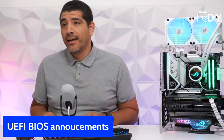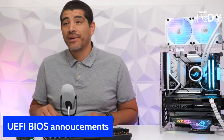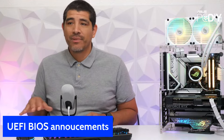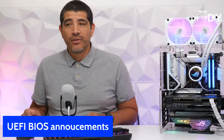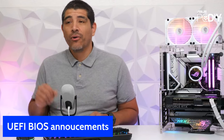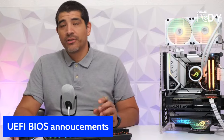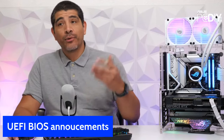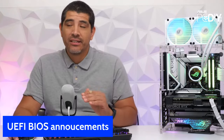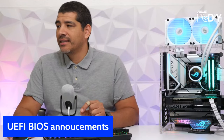So maybe you're running Z690 based motherboards, or maybe you're running one of the other socket 1700 series like B660 or an H series motherboard. We've continued to release UEFIs for those series of motherboards, but a whole new wave just went out today. It's important to keep in mind that if you do update the corresponding UEFI to support Intel next generation CPUs on those motherboards, you also want to make sure to update the Intel MEI firmware.